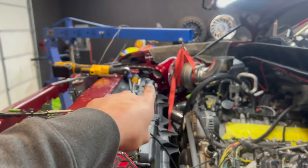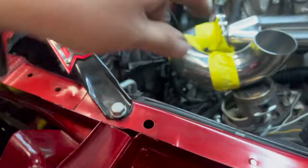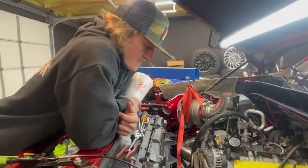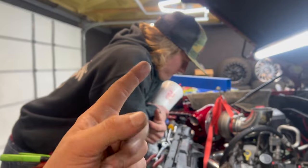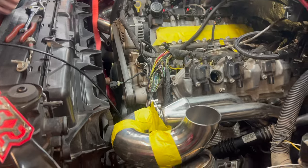You can actually put a five-inch exhaust pipe and close the hood so there's enough room right there. This side is going to look a little different because these are not mirrored turbos, so we're going to go up and then over. Other than that it should be pretty symmetrical. The main thing I'm focusing on is getting the exhaust symmetrical — if that's not right it's going to bug me. We also gotta figure out where we're going to put the wastegates — pretty sure we're going to put it off of this 90 here and go right here with it, and probably get hood flames too. We need four, not just two.